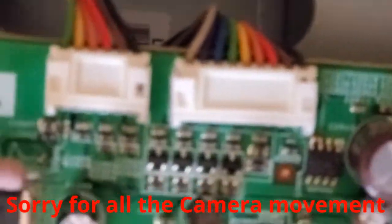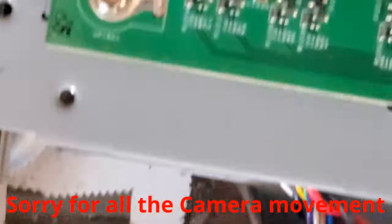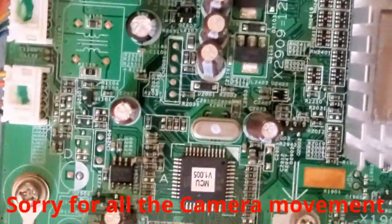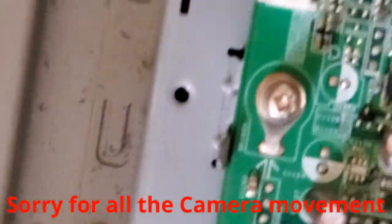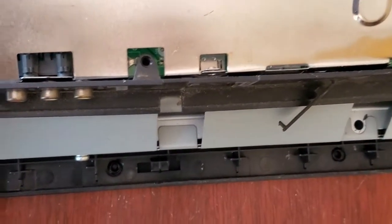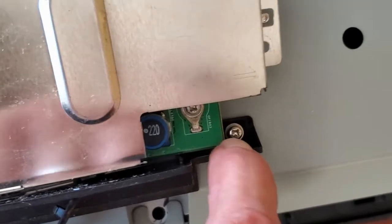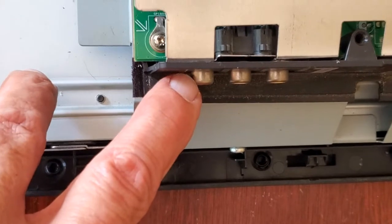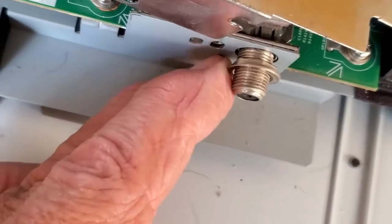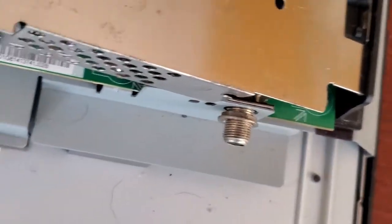Over here you're going to disconnect the same process — pull them up a little bit and they're going to come out. Take all these screws out; I have separate magnetic pans for all these so I don't mix them up. This is the new board I've already installed. Before you take your old board out, remove these screws and that screw there — this plastic piece can slip out, which allows these ends to slide out. Also do not forget this nut needs to come off — just get a pliers, it should come right off. This is for the cable TV coax end.